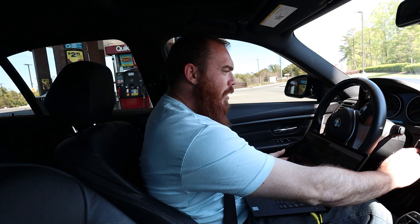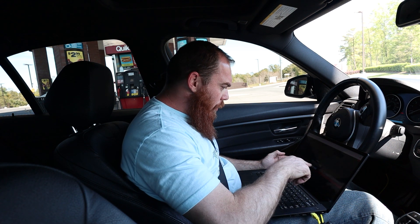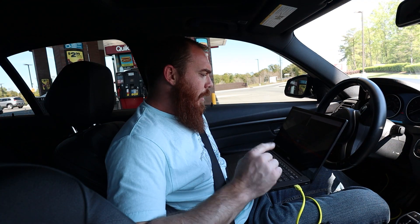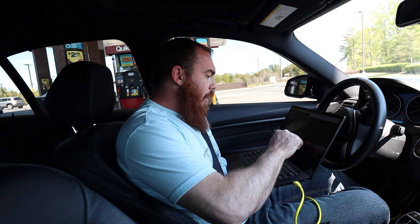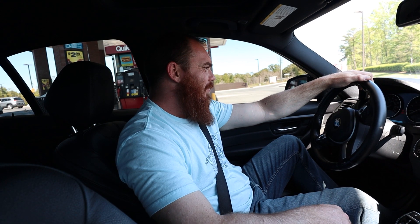We're at the gas station. I just did the ethanol and topped off with 93. Connecting to boot mode, we're going to turn off the car and get ready for a flash — doing it on-site connected to my phone. Since we have ethanol in the engine, I want to make sure we're not causing any damage. Turn on accessory only, radio and AC off, seat belt on — that's required. We're doing a Stage 2 E30 tune, not the aggressive version. Flash is at 99%... successful tune. I'll give it about 15 seconds before starting it up. All lights are off — we're good to head out.